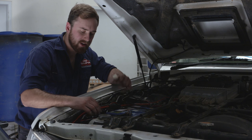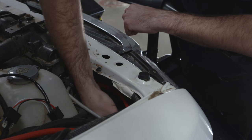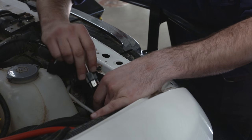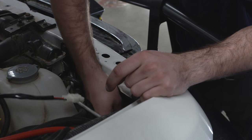The next wire you're going to grab from your relay is this one with the white plug. Connect that headlight adapter you identified before straight in like that. You're going to simply unplug the wiring from the back of your headlight and place this piggyback adapter in-line. First, place the male part into the existing wiring, and then the female part goes into the back of your headlight.